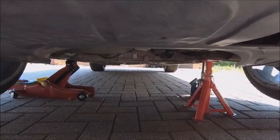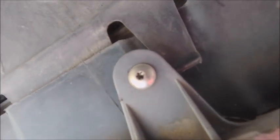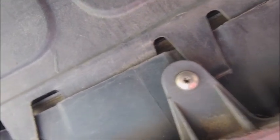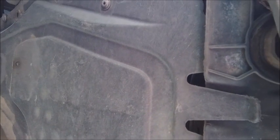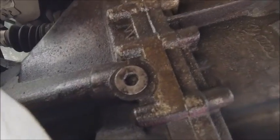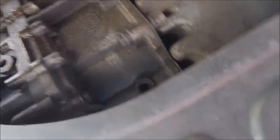What I've got to do now is get this under tray off. These are the wonderful things that Audi think are a great idea — basically there's about three clips that side and three that side. A little bit easier than the Weiss car — that one has a metal under tray which is a lot more difficult to get off than these plastic ones. I'm going to nip those screws off and then basically drop it down. The oil drain plug is up there — actually, that's the gearbox one. The filter and the oil drain plug will be visible as soon as I get this off.